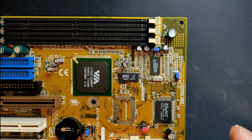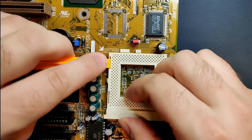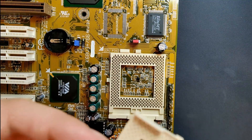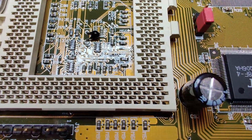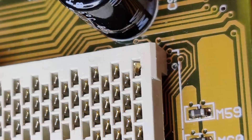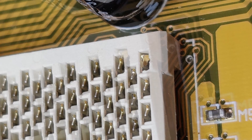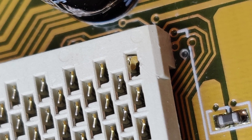Probably not the best place, but if you enjoyed this video so far, consider giving it a thumbs up. Anyway, looks like things have to first get worse before they get any better. After a lot of back and forth, I was finally able to remove the lid from the socket. And here we can see something odd in the corner — the metal plate inside the socket seems to be bent. When the pin of the CPU slides forward, it gets stuck at the metal and bends.